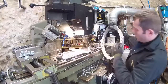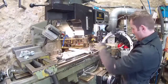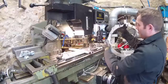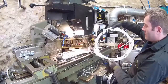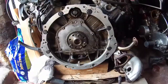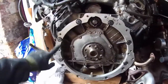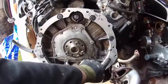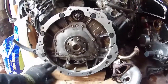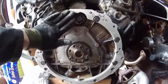There we are — you can see the dowels that we put in while machining this, to make sure everything stays in place. The adapter plate is bolted to the engine. We've got the six M12 fine bolts here and the four on the bottom — they all line up nicely. You can see it's all countersunk so we get a flat face for the gearbox to mount on. These are the engine dowels — they line up nicely.